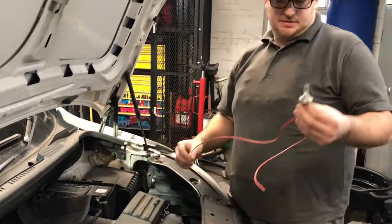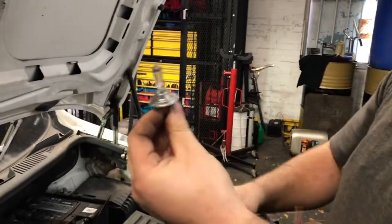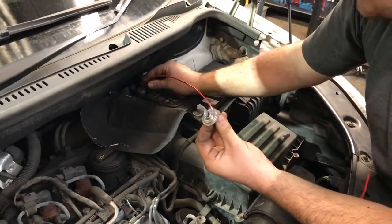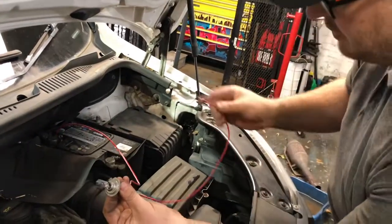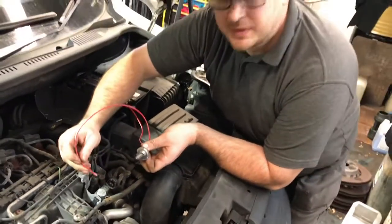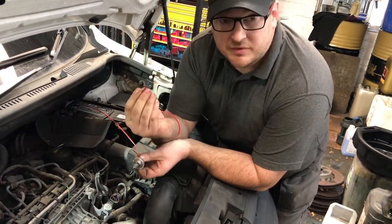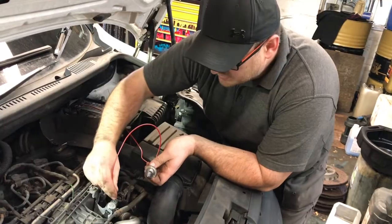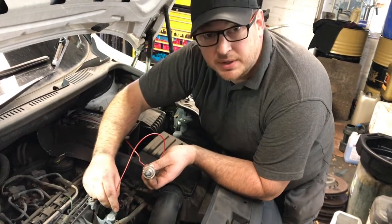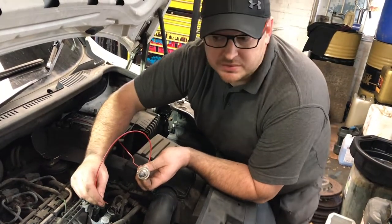With the window mechanism, what we've got here is your test light going from a ground — which will be a battery ground, or from the body of the car, any kind of ground. When you feed the computer system on your window regulator, you are sending that ground through the element of the bulb to the other end of your wire, to fool the computer into thinking it's seeing a ground, which will be your switch and would operate the window mechanism. Because this is what's called low-side switching — the high-side switching is done by the module itself.